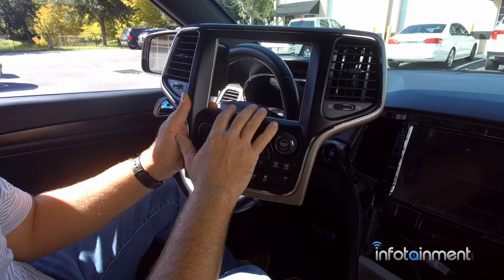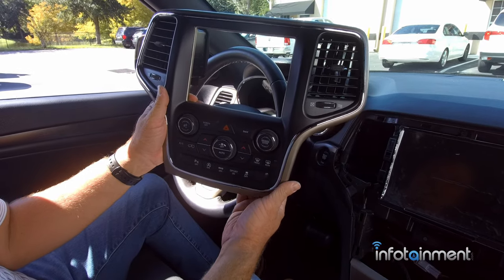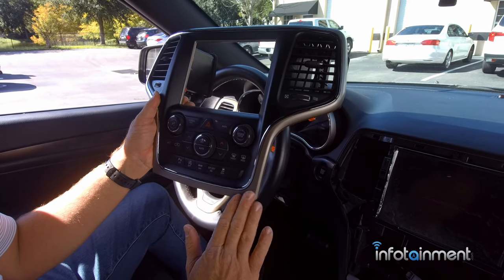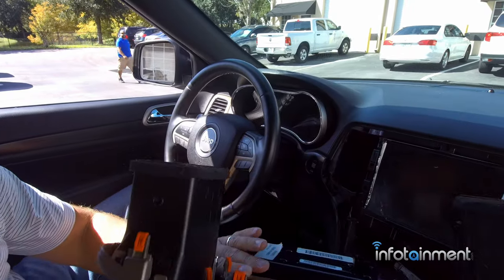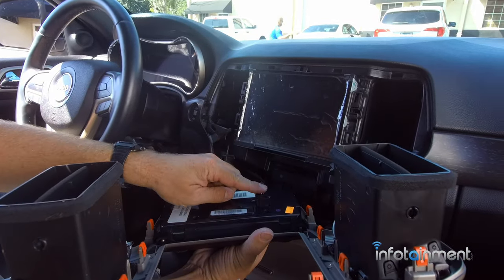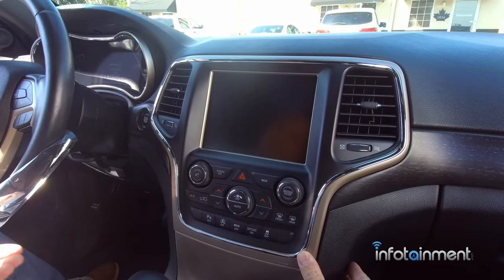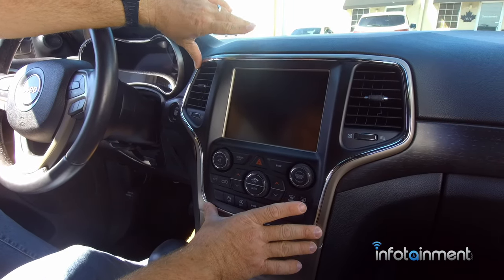Because the other bezel has a smaller cutout for the smaller radio, we include the larger bezel with the 8.4-inch cutout. These bezels come in different colors and variations, so be sure to give us your VIN number so we can supply the right one. It pops into the exact same location. Go ahead and plug the climate control connector in, remove the screen cover, and it simply pops right in.